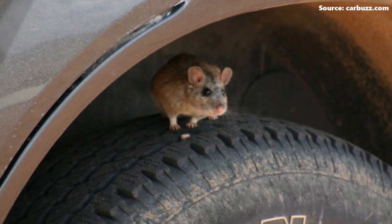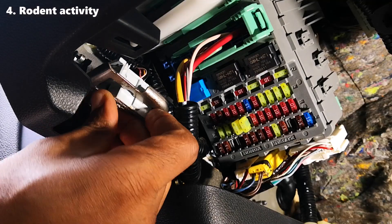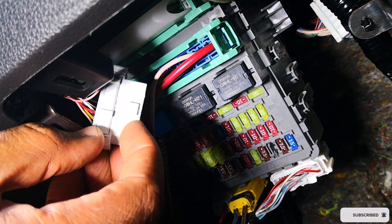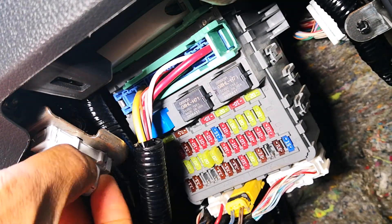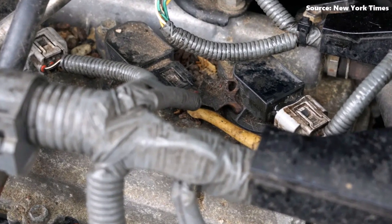The fourth reason is annoying as well. It's not uncommon for rats to have chewed up some wiring, so you may have to detach the OBD2 port and loosen some of the panels just to rule this out. That said, I only suspect rodent activity as a cause if I've seen other evidence suggesting an infestation, such as having rat droppings in the car.